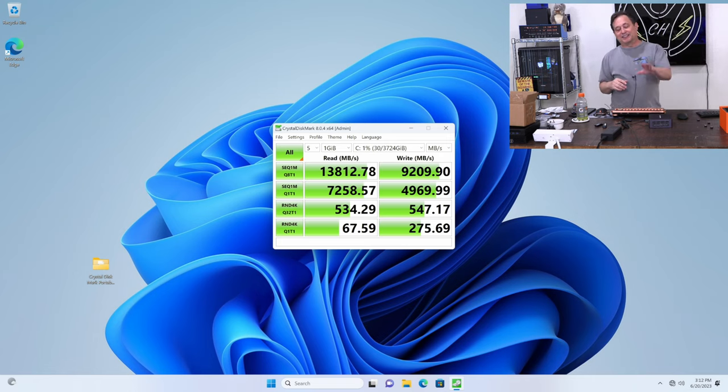Now, for a system like this that's not playing a critical role, what I would likely do is, once I have all my drivers set up and get the system configured the way I like it, I'll use Acronis and make a system image of it. But I also have to make a special Acronis rescue disk with the RAID driver injected into it. And Acronis offers you that option during the media creation process to add any added drivers to the boot media. So they make it really simple. And in theory, I could replace all of my Acronis boot media with one with that driver, because loading it when you don't need it doesn't hurt anything. But it does add an extra step. It adds an extra level of complexity, but then you get these amazing numbers.